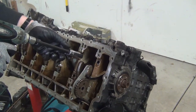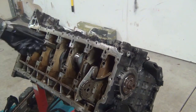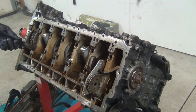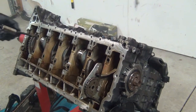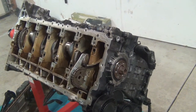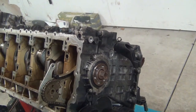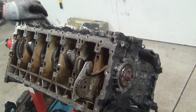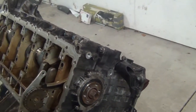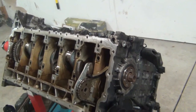Mind you, like I said, I loosened these up with a breaker bar first. That's all the big ones. Now there's a couple of E-bolts up here, and when you see that blue head, that means they're aluminum, which BMW dictates as being non-reusable — which is correct. If you're ever working on these engines and you see a blue-headed bolt like that, never ever reuse them. Ever. Or you'll have what happened to this engine — they'll probably break off.